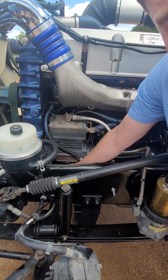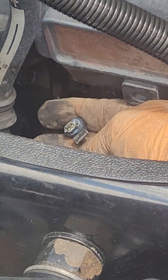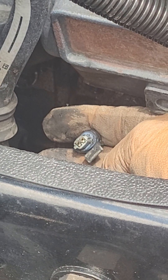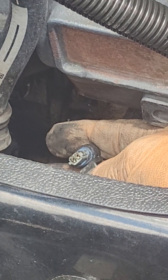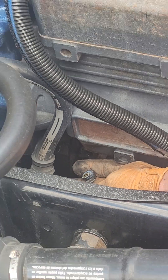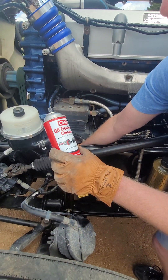If you can see inside this plug, there's a tiny bit of oil inside those prongs. That's because as it leaks, it runs down the wires and will interrupt the signal to the ECM. If it's really bad, it'll completely interrupt it. Even just a small amount like this was giving me problems every once in a while.